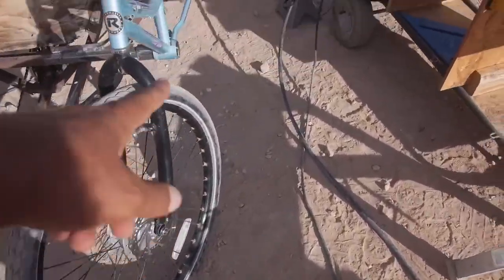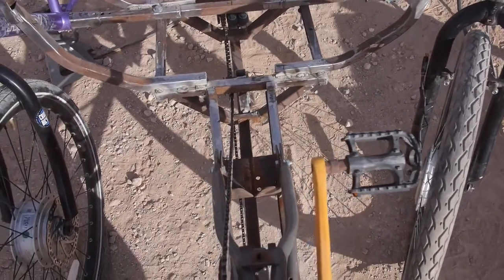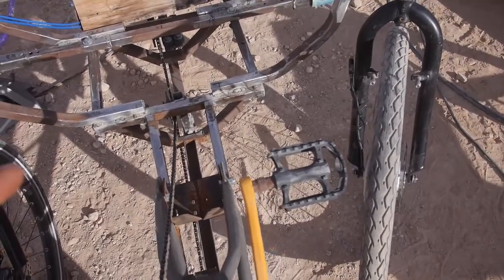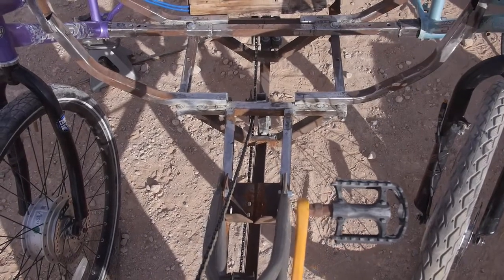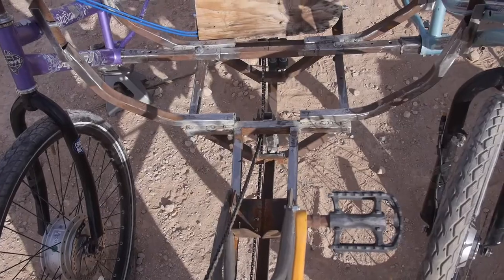Quitting time — it's 4:30 on the 2nd of November. Those will connect to the axle nuts and go back. About 8 inches back from the axle on the inboard side is where the tie rod will come off and come to the middle. But I'm not going to put that on yet — I haven't invented the middle part yet. The middle part is where I'm going to do that multi-link setup so the steering works right in the corners. Then from that I'll work on getting everything as straight as I can when going straight, set my alignment, and then start testing to see if it turns right.